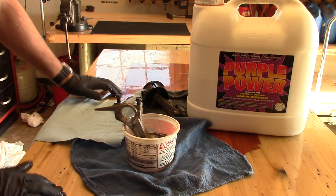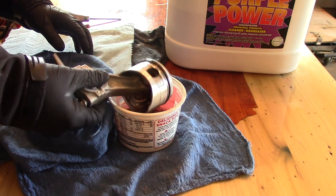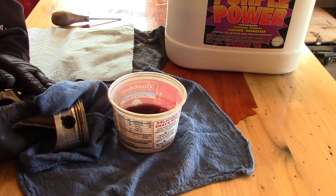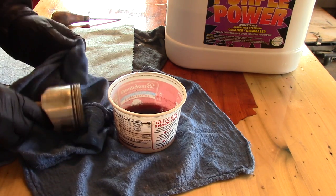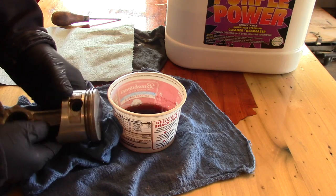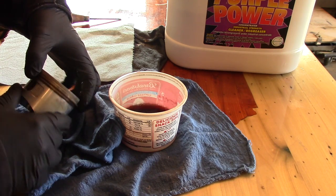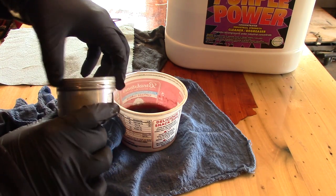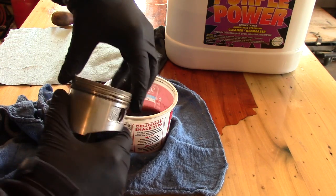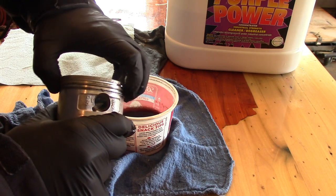There's no risk of really damaging the piston this way. It's a day later folks, and we're going to take a look at this and see what we have. It looks nice and clean — there's a little bit of oxidation or rust there. The second ring is actually completely free, but the top ring is still stuck and the oil ring also appears to be stuck.